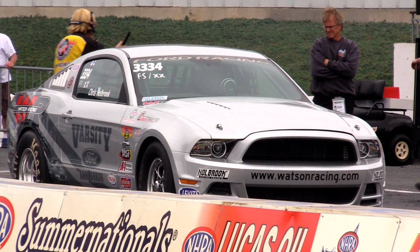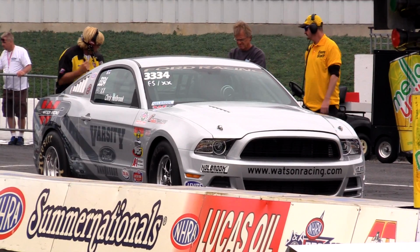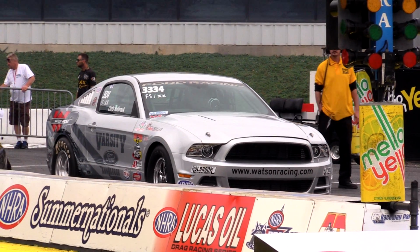So everybody's getting the job done on different types of product. We're running Penske's. You got other people running Strange, Lamb. There's a lot of different combinations out here, and we just keep having to figure it out because we keep sneaking up and making more horsepower and making these cars run better. It's just a combination of getting them calmed down on the starting line and then rolling enough timing in down the track to make them run fast on the big end.